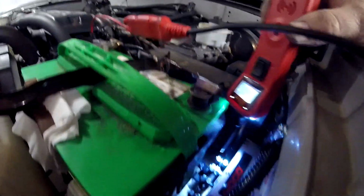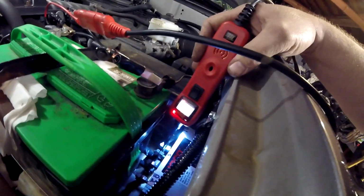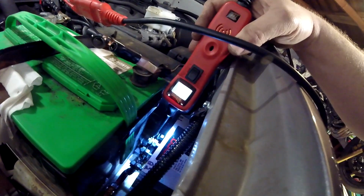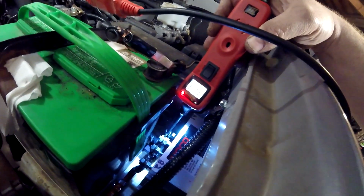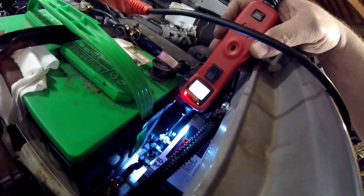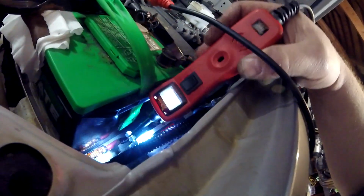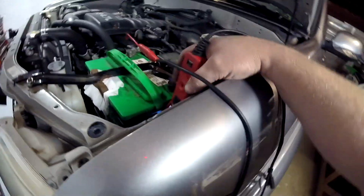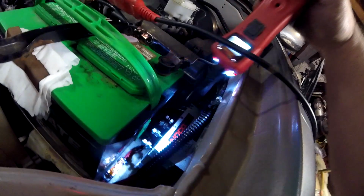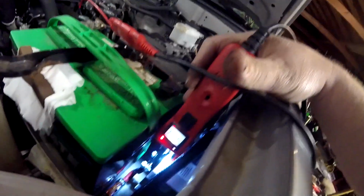We're going to have 12.5 here. That's battery 1. The alternator is 12.1. There's voltage drop back through the alternator circuit because the vehicle's not running. The sensor should be a battery, which is 12.5, and this should be down in the 11s. Oh no, that's right, it's higher now. The other day when we did this test, there was a lot of voltage drop through the isolator, and this was down in the 11s. Now you see it's up at 12.7.